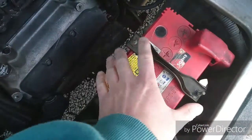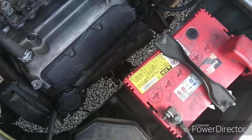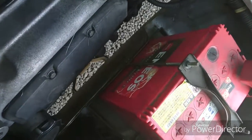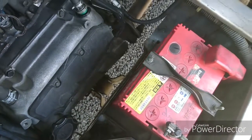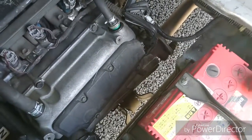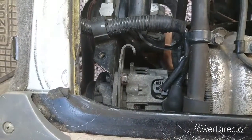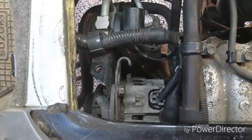Tiny, tiny battery — which is why I upgraded it in the carry truck. This is okay for just running the engine, but if you put a stereo or anything in it, you're just not going to have enough power. With the alternator only being 45 amps, it's just not sufficient to run any kind of audio system.